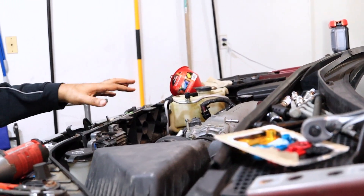I fixed this car because I don't want to have to give up on yet another car. I just finished swapping this new engine in here. When you get a new engine, it's called a 'dry engine' in the industry — a dry engine means it doesn't have any oil in it, it's never had any oil go through it. Normally when they build an engine they'll put some special lubricant on it, but this engine has been sitting for over two and a half years, so that lubricant is probably all gone, meaning we really need to prime this.